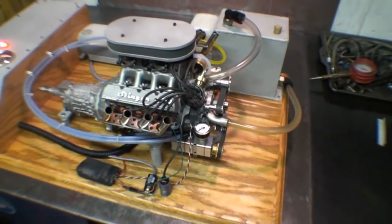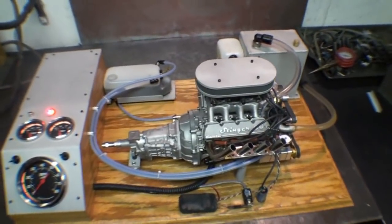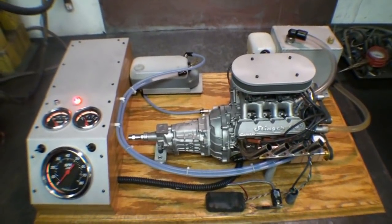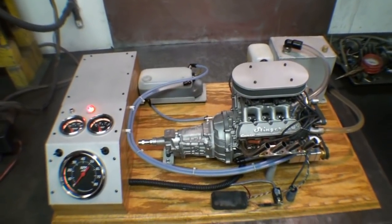And then the other question to ask is why are the headers on backwards? They're actually not on backwards — it's just that if you're standing over on the left and they were turned around, you would get a big face full of exhaust every time, which would not be comfortable. So turning them around backwards gets it out of your way.